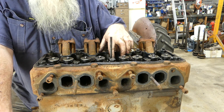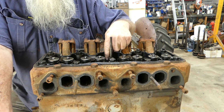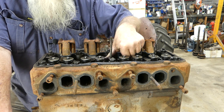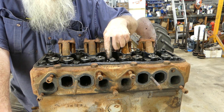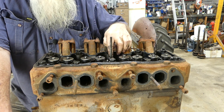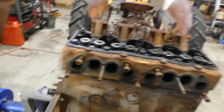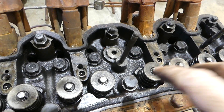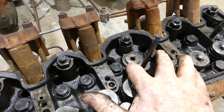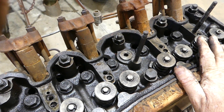Worth mentioning — with these 23C heads they actually had a white metal plug down in the head, and that would eat through and put water into your oil. This one has a stainless steel hex plug put in there. I'll give you a look at it. Normally I believe it's white metal, but there's a thread there you can clean out and put a brass plug in on petrol engines. For diesels — leave me a message if you know the answer.